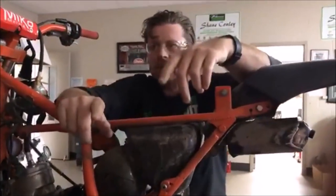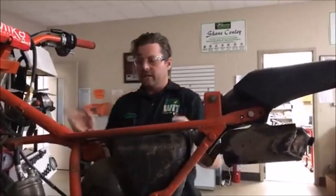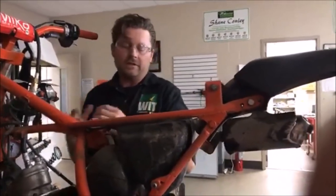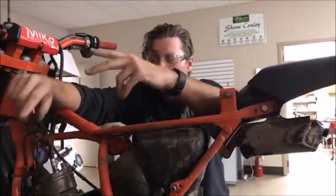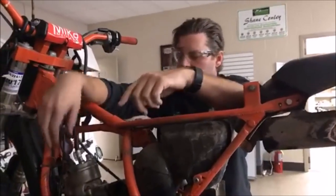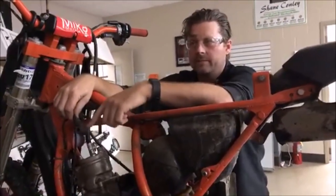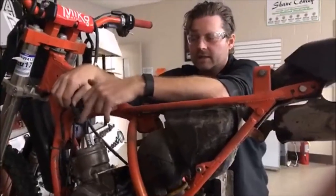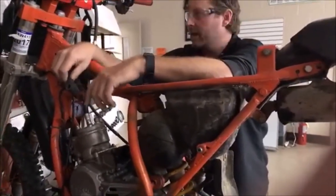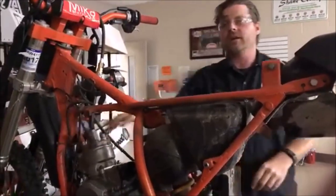This is another good thing you guys can see too — we got the lights turned out. Even on a running vehicle, it's not a terrible idea to dim the lights in the shop, get the vehicle running, and get down there to look. You're looking to see how the wires, cap, and everything are going. The whole point of this was to maximize all the data we can get on the work order. Now Jesse can see he needs to put a new cap on, and he didn't even know this was a problem. Would you have caught this on an engine rebuild? No — because if it runs, it has spark, so you're not paying attention to the cap. Do you know how much this cap is? Try $3 to $5, maybe $7. They're cheap, and that's a very inexpensive item to go ahead and fix while you're in here.